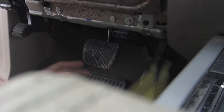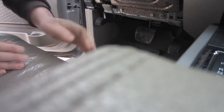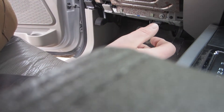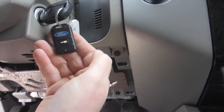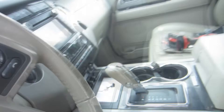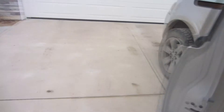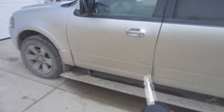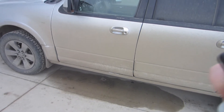We're in option seven now. At this point, take the key fob and press the remote start button. The LED should be off — and the LED is off. Now turn the key off and shut the door.